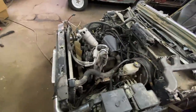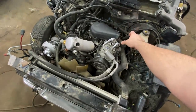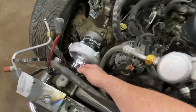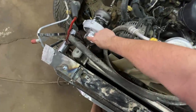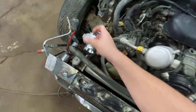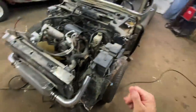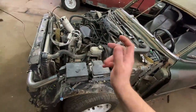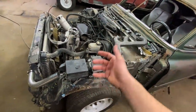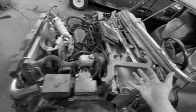But we should still be able to make it all work — we're just going to have to do some funky bends. Another thing people said was my mass airflow sensor needs to go on the front of the turbo. I had thought you could still run it back there, so that was helpful. I'm going to figure out how to get a 90 in there and then have it right before the filter. So it'll go: filter, mass airflow sensor, into the turbo.